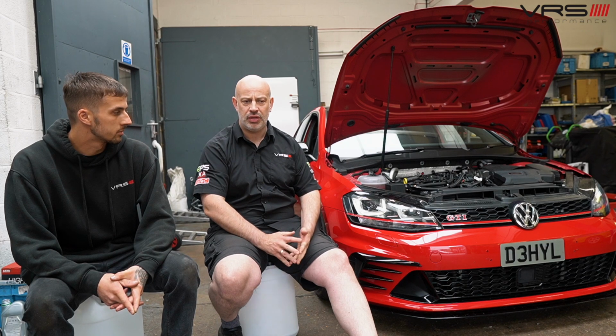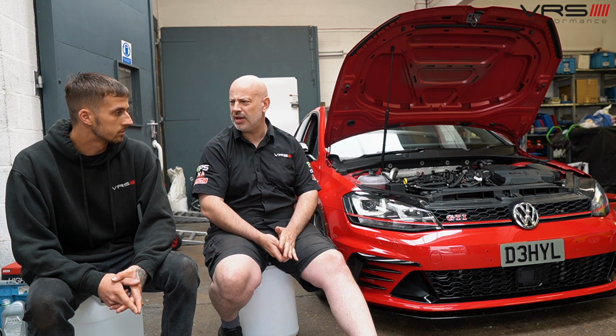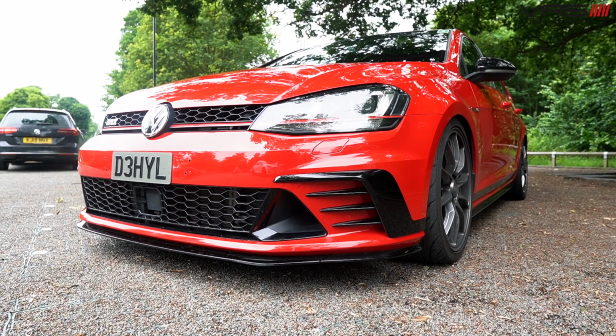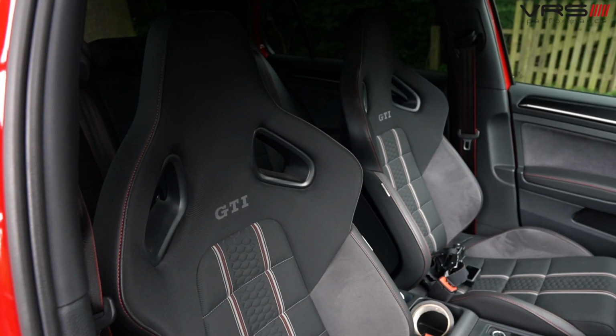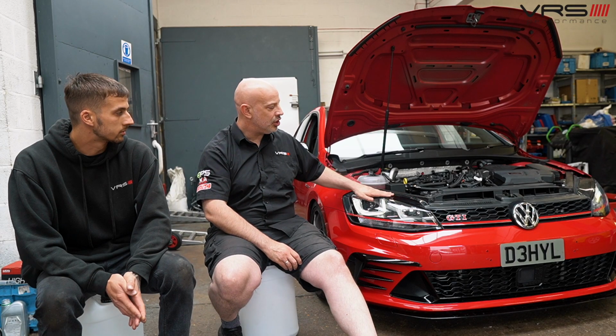Yeah. ECS Tuning rear brakes, they're just the disc and bell basically with a DS2500 pad, I think. Got the F6R Mintex front pads in, which are really good, and then obviously just in red with the big wing seats. And that's it basically, isn't it? It runs about 520 horsepower. With the meth, you can turn it up.